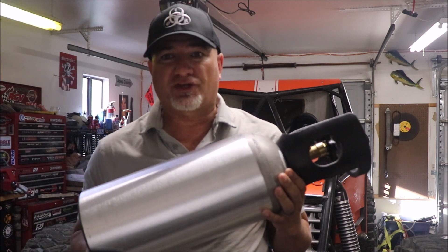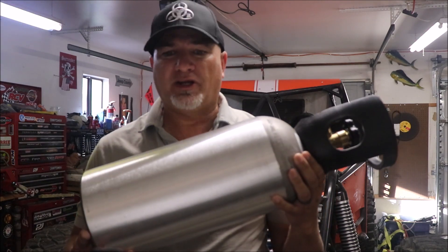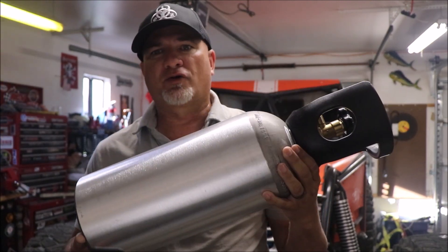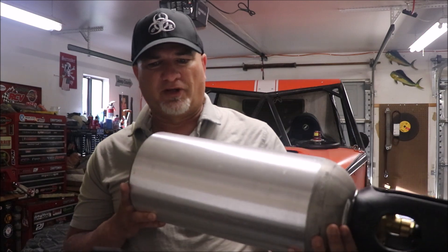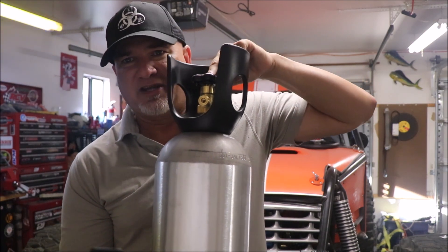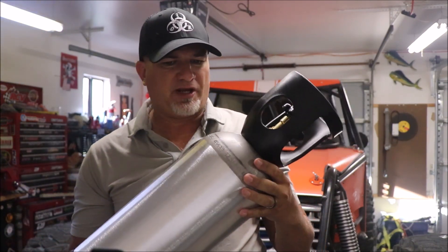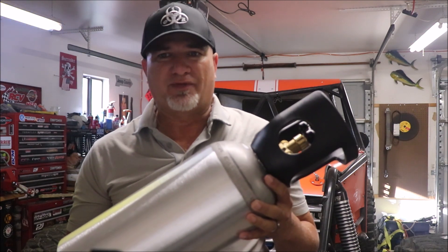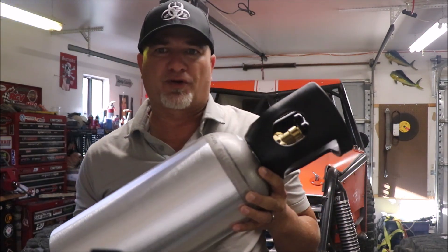The first item we need to order is a tank. A 10- or 15-pound tank is the perfect size for off-roading. I personally prefer the 10-pound size for its ease of mounting — a tank this small can last for a few off-road trips, even when airing up 40-inch tires. Aluminum or steel construction doesn't really matter. Just make sure you purchase a tank with a CGA 320 valve, and make sure the certification date is recent. CO2 tanks need to be tested and recertified every five years, so don't get stuck buying a tank on Amazon that's about to expire. Many vendors on Amazon and eBay guarantee recent certification.